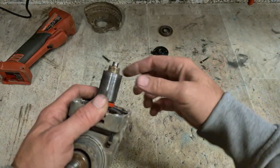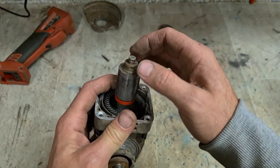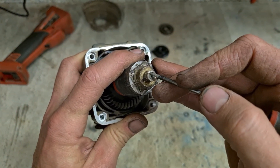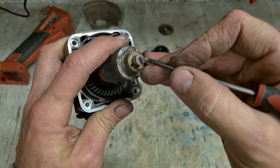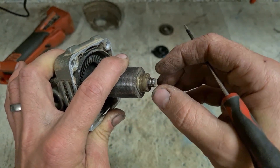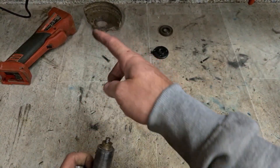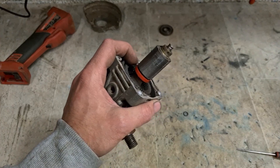I'm going to do the normal way to take these off. You can get specialist equipment for gripping this and pulling it off, or you can grip it in a vise and give it a sharp pull — sometimes it comes off. Generally the way I always do it is with a grinder. Take a grinder with a wee thin one-millimetre disc and just grind it back, just to start to touch the inner shaft. That'll break the clamping hold of the bearing on the shaft and you can just pull it straight off. This is definitely a repair anybody can do at home — if you have a cordless grinder you're more than likely going to have a corded one, so pull out your old corded grinder to fix your new brushless one.